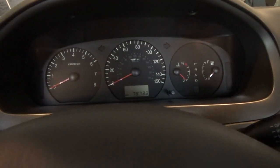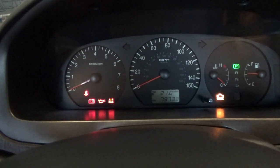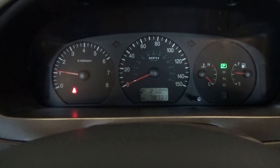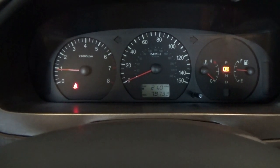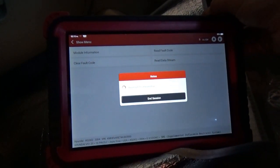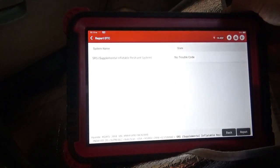Wait for it to go to sleep. It's flashing — three, four. Now it's not there. Just read fault code again. No trouble code. That's interesting. Usually on airbag systems, if there is no fault, the light will go out on the next ignition cycle. So the owner will keep me updated if the light comes back, if he wants me to do a follow-up diagnosis. But that's it for now. Thanks for watching, we'll see you next time.